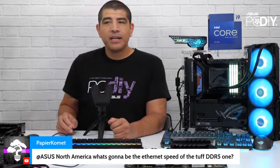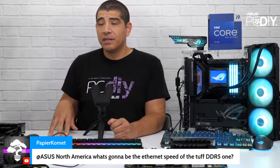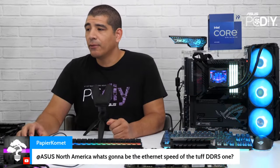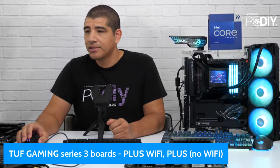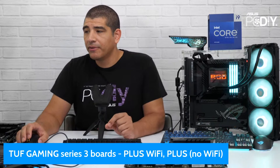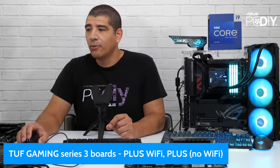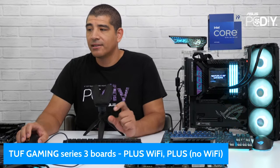What's the speed on the Ethernet? If I didn't note that, it is still 2.5 gigabit. So it's still the I226 2.5 gigabit on both the DDR4 and the DDR5. So there's no difference. You're still going to have 2.5 gigabit on both of those motherboards. It's only the difference in terms of the Wi-Fi specification, where you have Wi-Fi 6 and Wi-Fi 6E.